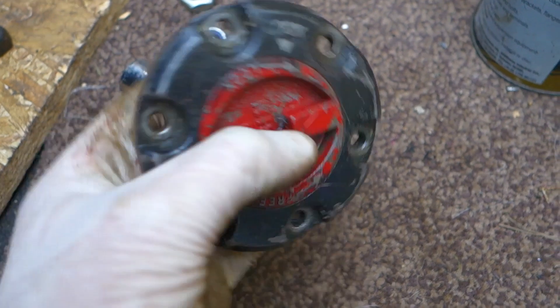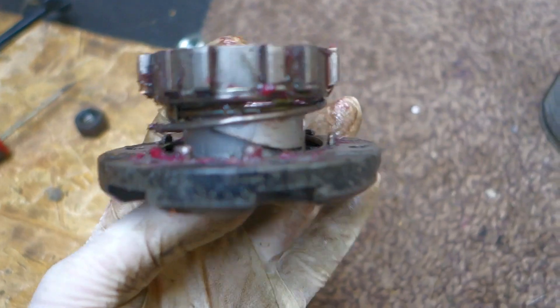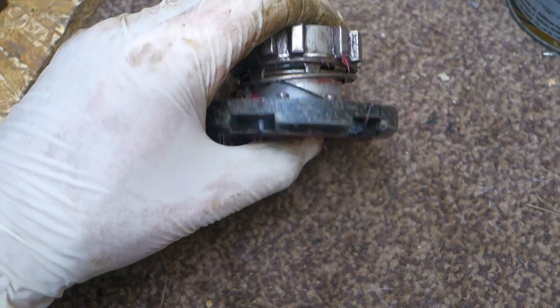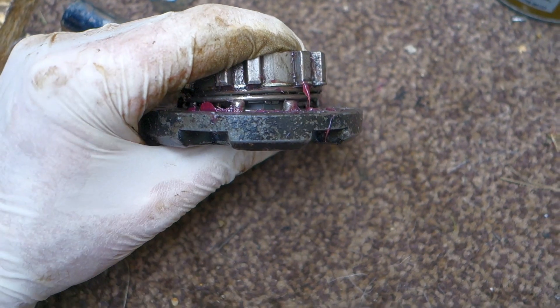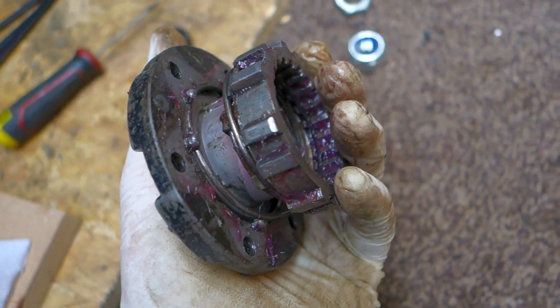Piece of piss really, these. If you don't look after these and keep them greased, all the shit gets in there. What happens is when you come to either unlock or lock, if it's jammed in and it's all rusted up and the spring's broke or it's just full of shit, it just won't move - it'll either stay in or stay out. You just need to whip these off, clean them and grease them up.